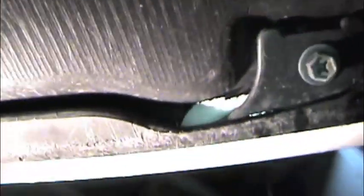Anyway, so, underneath the car, right? Need to take off this front plastic piece right here. It's about a foot long. There's four screws in the back. I believe nine total on the front, and then there's some hidden ones, and once I get some of this stuff off, I'll show you it. Once this is off, the bumper should just come off nicely, and then expose the headlights, or the headlight case, and the fog lights, and the fog lights need to be disconnected before you pull the bumper off.